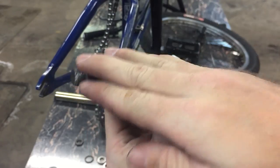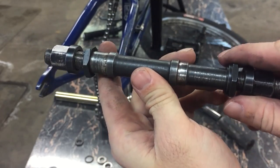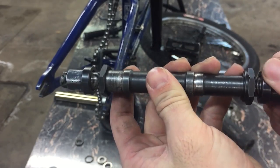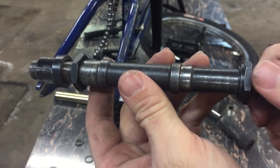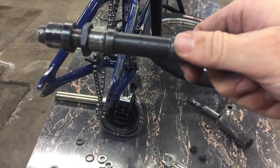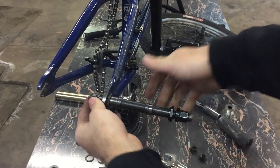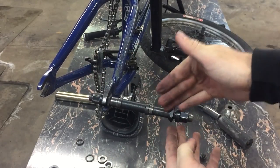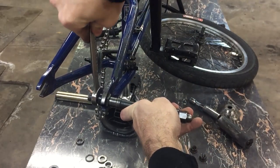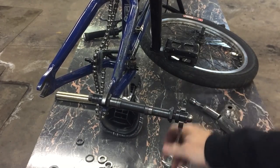Let's just say that you don't have a place to put an allen wrench in your axle, or for whatever reason, you have to find some other way to get stuck hardware off. What you can do, provided that you can get your wheel off, is put your wheel into your dropout sticking out like this — so that your stuck hardware is facing out. When you tighten it down, it gives you access to loosen your stuck hardware very easily.